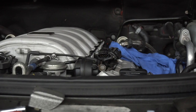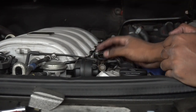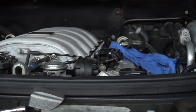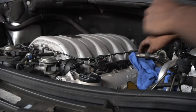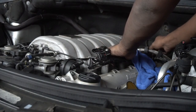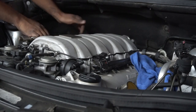Once you've unplugged all the fuel injectors, there are four T30 Torx screws around the intake manifold which will allow you to release the fuel rail. There's one over here, one over there, and two on the other side in the exact same positions. Take those out and keep them carefully. With those four screws out, all you've got to do is pull on the fuel rail gently — they're moving a little bit — and there we go, we've got them out on both sides.